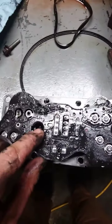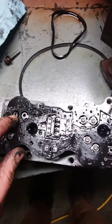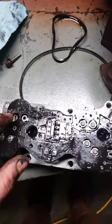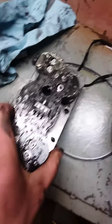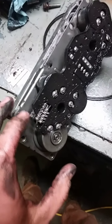After you take out the two screws here, you can put a soldering iron against this, get it hot, take an O-ring pick and just lift up on it a little bit. It'll drop down. As you can see here, I kind of got it lifted and she's loose in there now, but in order to get it out, I will have to desolder all these to lift the whole unit up.